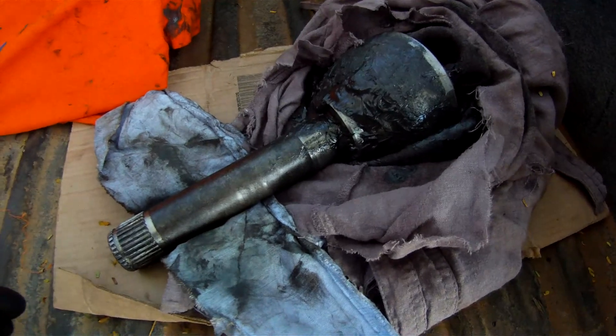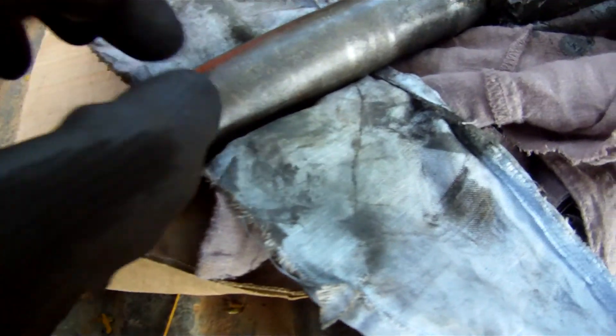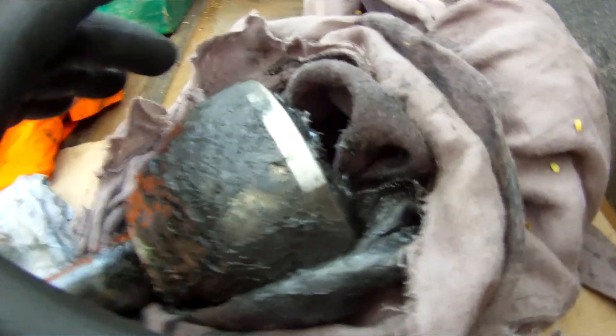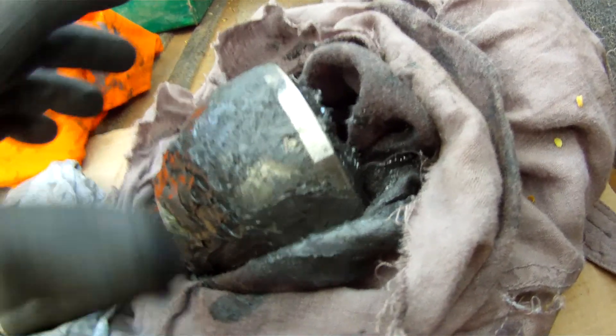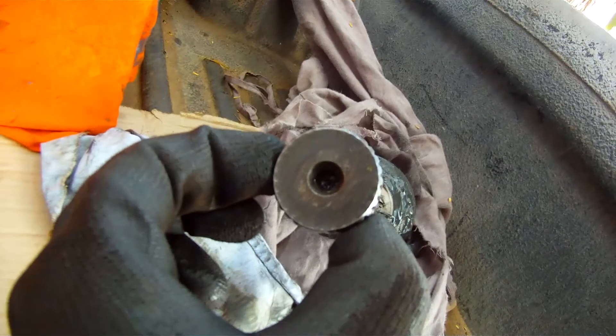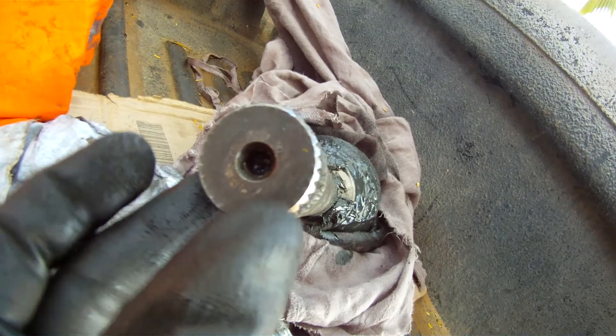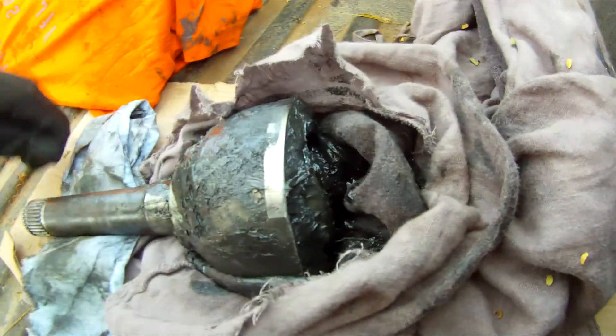The CV joint is the same sort of thing — it's got the area for the circlip, the splines, and the shaft where the needle roller bearing runs — and the whole body of the CV joint actually seems a bit bigger than the Land Rover's. I don't know if that means it's stronger, but possibly so — I have heard that the shafts are stronger and it does look a little bit larger diameter. Half shafts are only a problem if you drive like a maniac or you're rock crawling and spinning the wheels excessively — you can get away with not breaking Land Rover shafts if you drive sensibly.